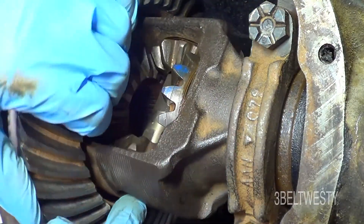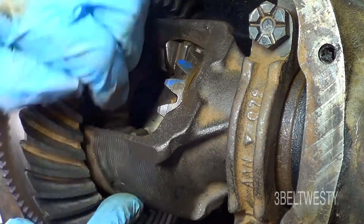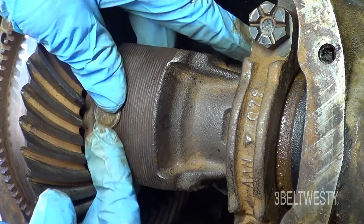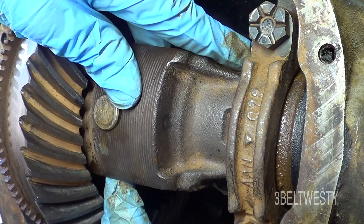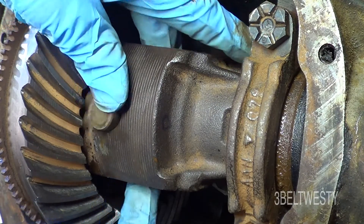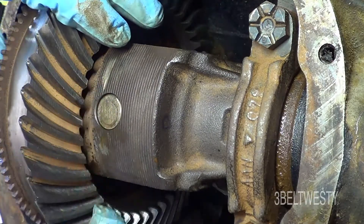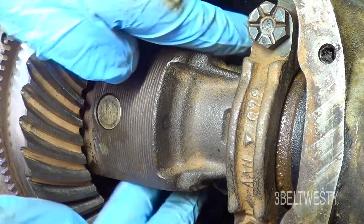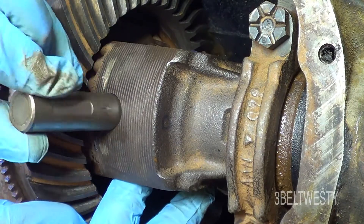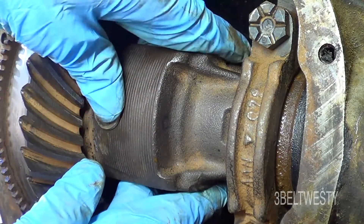Now I can pull this out to inspect it — that's the purpose. Some of these you just can't get the pin out otherwise. I'm replacing the axles and that threw me for a loop. I Googled it and found someone mentioning they couldn't get it out with a 4.10 gear set either. If you're building a new gear set from scratch, I'd almost want to grind that tooth before you even put oil in. After this, hit it with brake cleaner to get all the debris out — you don't want that in the bearing. Now it completely pulls out.